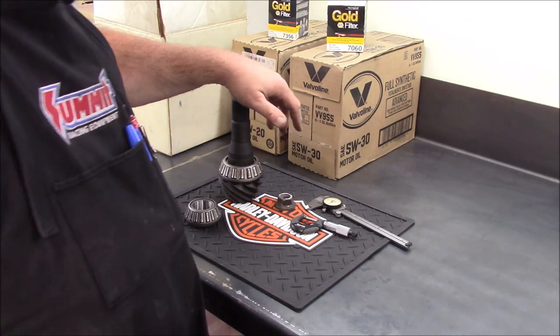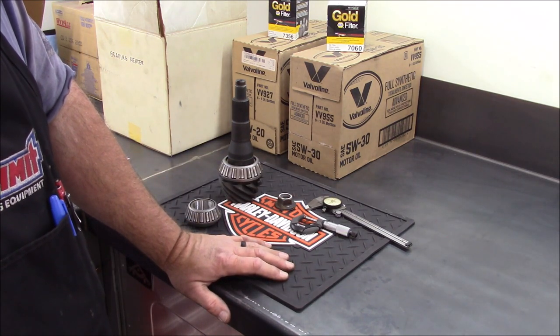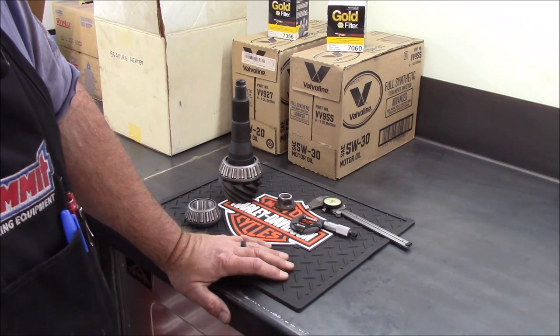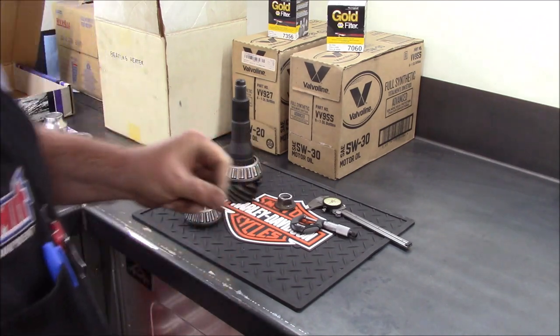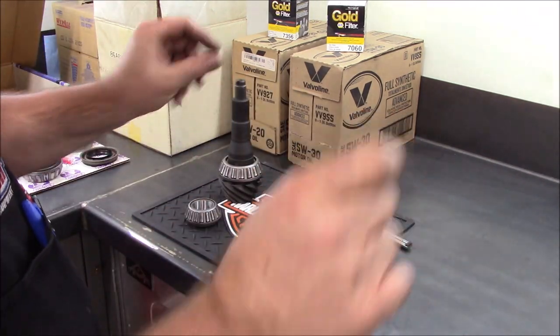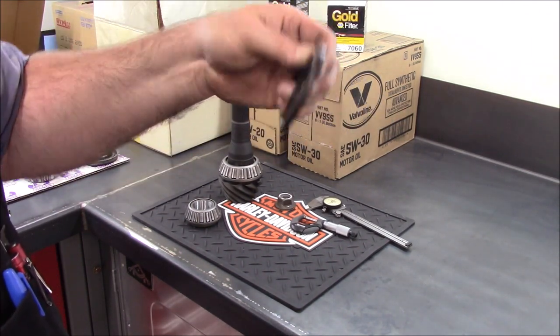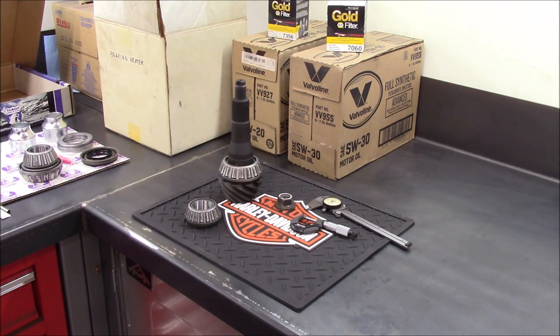On the specs, I think Spicer, Dana, and even Ford on some older service manuals used to say 10 thousandths of preload — but that's kind of hard to measure. So I usually take the original shims on the right and left side, measure those, and try to stay with that same overall thickness. If I'm working on one somebody else has been into and I'm not quite sure, I will go solely off of carrier preload.